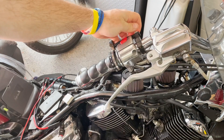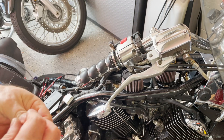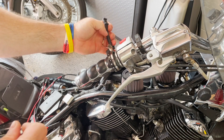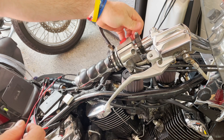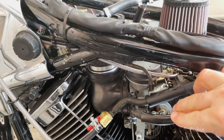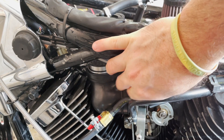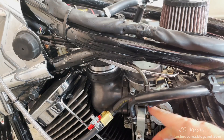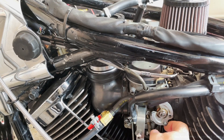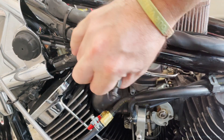This clearance here is a friction cruise control. I'm going to remove this screw that I've already loosened, which separates this bar and gets it out of the way. I put the screw back so it doesn't get lost. I pre-loosened the fitting for the other cable, so now I can just turn it anti-clockwise with my hands. As I do that, the cable continues to slack and I can push it down over that ramp, then come around and remove that cable from the spool.